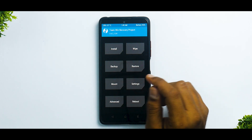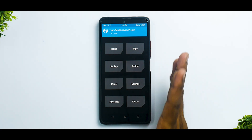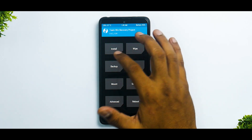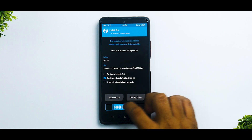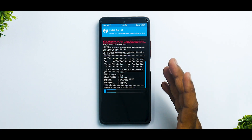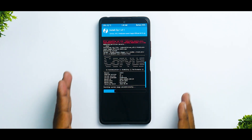Now while flashing the firmware, just make sure you always flash the latest firmware for your specific region. I am on the latest Indian update so no worries there. I'll go to Install and directly flash the ROM, then swipe to confirm flash. Now of course this is a complete ROM — around 1.7 gigabytes — so it'll take about 45 seconds to a minute to be flashed. So please be patient while that happens.